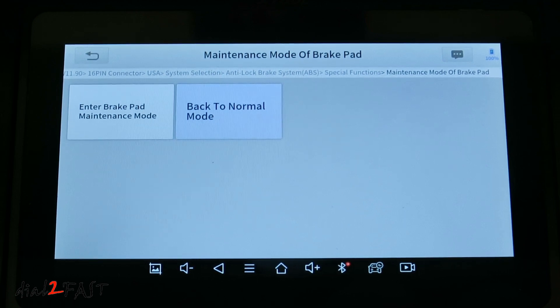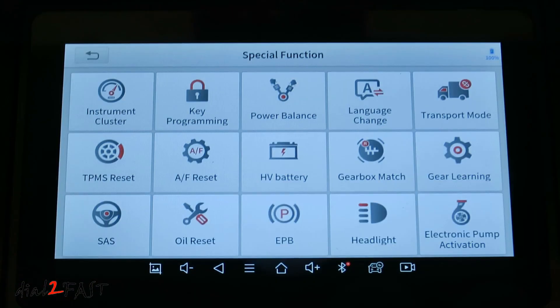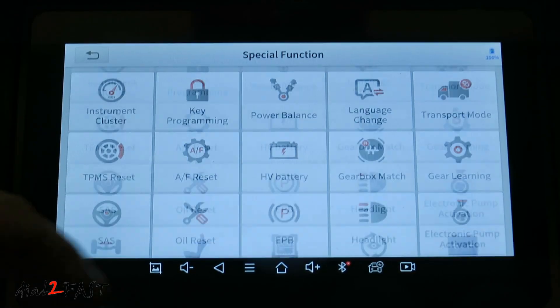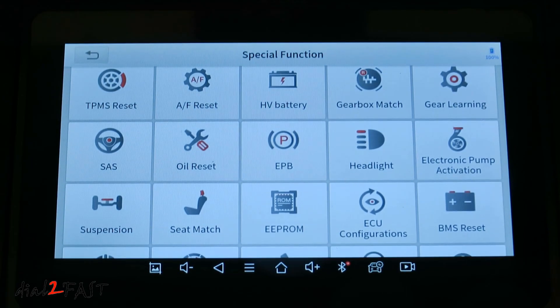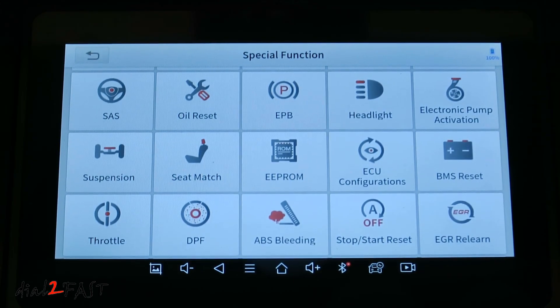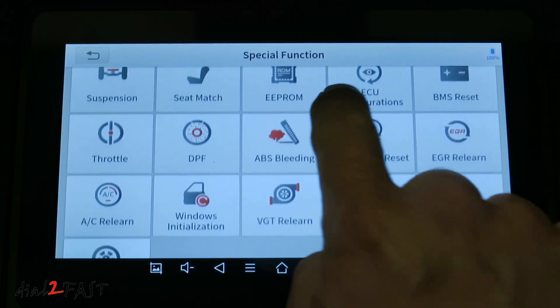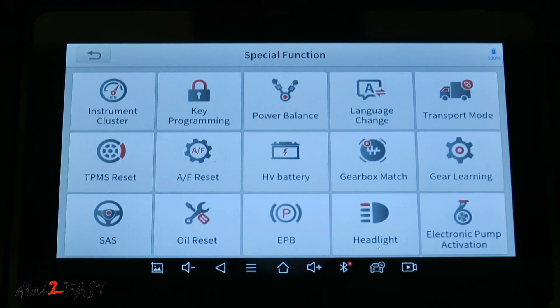So there's a two-way communication between the tool and the vehicle, hence the name bi-directional. The bi-directional function can be very useful for troubleshooting because you can have the tool send out commands to test whether a component is working properly. Just keep in mind your vehicle also needs to support this bi-directional communication for some of these features to work. Now let's go into the special function. Here's a list of all the special functions available — depending on the vehicle you have, it might not support any of these. You have key programming, SAS or steering angle sensor — for example, on some Toyotas after you replace the steering rack you have to reset the sensor. BMS is battery management system — on some vehicles if you change your car battery, you have to reset the low battery voltage fault or you'll get a warning light on the dash. The throttle function is to reset the throttle position sensor — if you do maintenance or clean the throttle body, you might need to reset the idle speed. It does have many special functions, and again it depends on the vehicle.